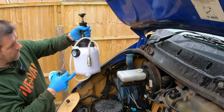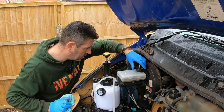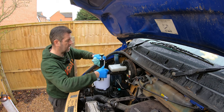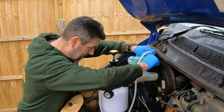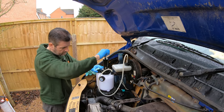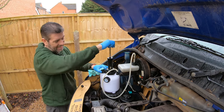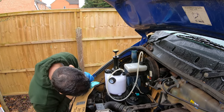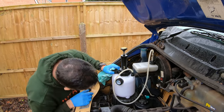Next, what I do have is a brake pressure bleeder. I've got this special cap that will replace the original cap on the brake reservoir — screw that into place, make sure it's tight. There's a quick release coupling on the brake pressure bleeder; clicking that into place and pressurising it up to around about 20 psi. That in turn will fill up the brake reservoir and help to bleed the brake system on the van. Pump it up a bit more — not quite 20 psi yet. There we go, 20 psi.